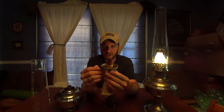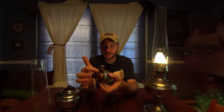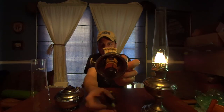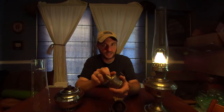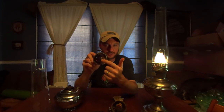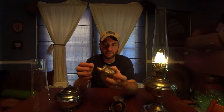So this wick rises up and down. And there's little tabs on the side of your wick, which you'll see. You can see right in here that this assembly catches on. This is a spare for this one or this one just in case. So I'm now set up that I have some spares. This riser arm though, the teeth were not engaging on the up, and it also came with a 23 wick on, which was the wrong size, which caused some problems and bent the teeth. There's also a little mini burner in here, and it usually says model 11. This is an aftermarket that somebody put in. Well, it doesn't quite fit, so it needs to be tapped out from the inside. A little dowel will do that, but they normally just pop right out.